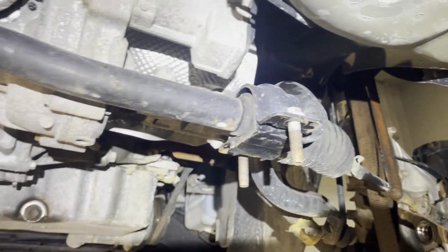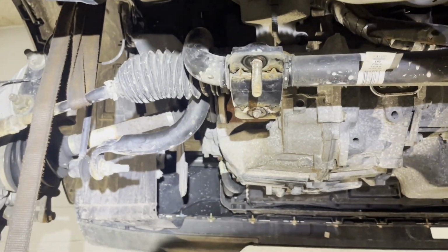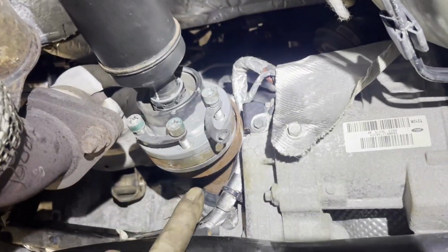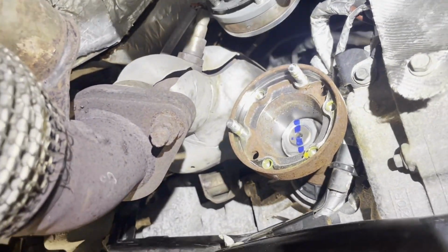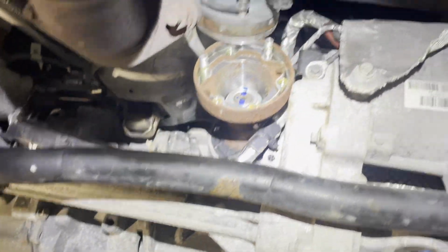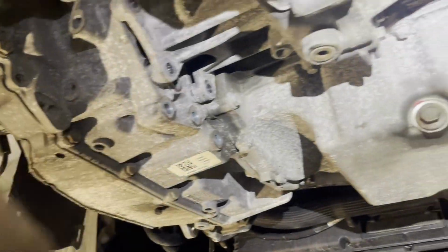There's the sway bar bolts. Like I said, I heated those nuts up underneath. One issue I had was 2 of these damn drive shaft bolts broke off in the yoke for the T-case there. I'm gonna have to heat those up and get those studs removed and get some new bolts. I mean, all these bolts came out super hard. All the T-case bolts came out hard.